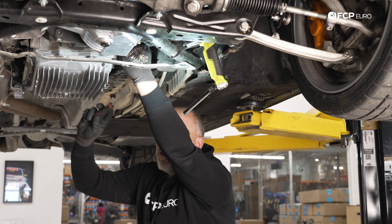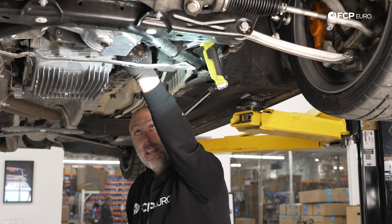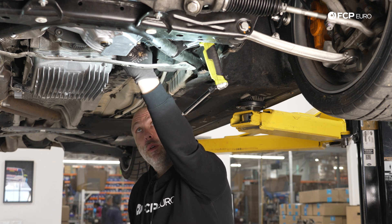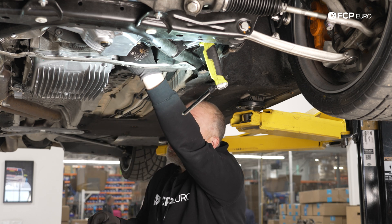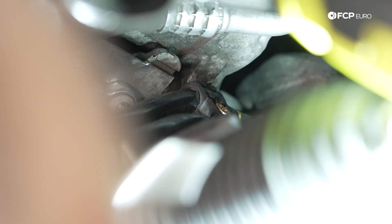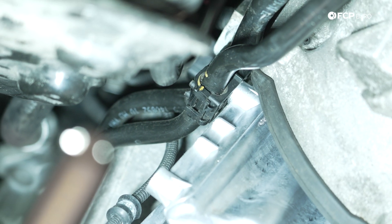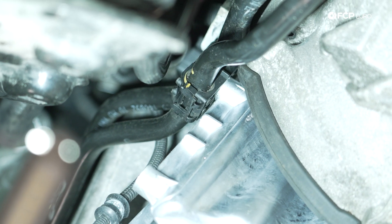At this point it's also worth making sure that the O-rings are still attached to the inlet and the outlet. They should come out with the line, but if they are missing that would be a problem because they could still be stuck in there. So just make sure they came out with the line. We have a couple of mounting points on the side of the engine — one here next to the oil pan, and another one just above the steering rack. Those are the two main mounting points to the engine that you're going to have to undo. Normally these would be E8s, but when we put this car back together we swapped those out to T30s because the internal drive doesn't interfere with the mounting clips.